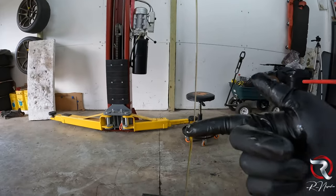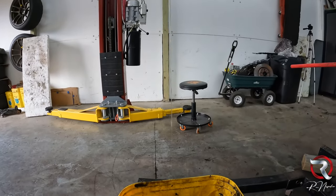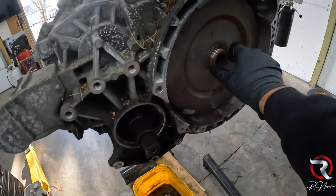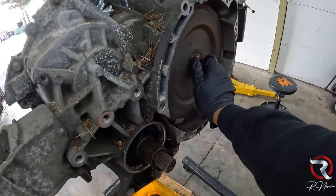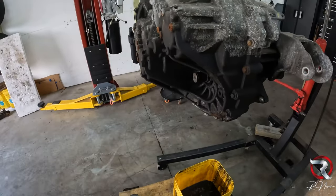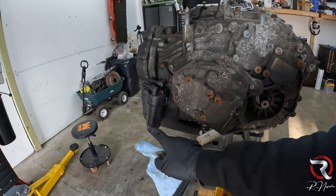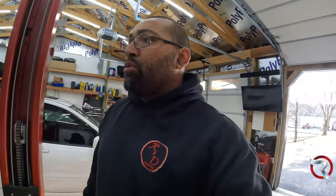As you can tell, it does not look bad at all. I did keep up with my regular maintenance on this SST. Like I said before, it was just about time. The car has over 216,000 miles on it and I think it was just the time to go. I don't know exactly how to see if these things are bad or not, but all I can tell you is that everything spins. I don't exactly know what's going on with it, but all I do know is that there was something wrong. What I'm going to do is let the rest of this drain out, pull the filter which is here — the filter housing is here — let any fluid out of that go, and then pull everything I need to wrap this bad boy up.